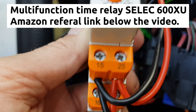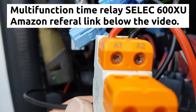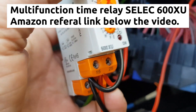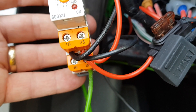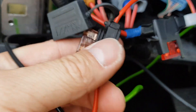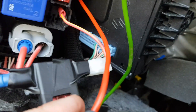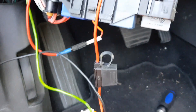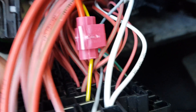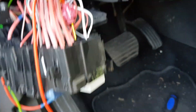From fuse number 25, you need to make a straight connection up to number A1. Then again from number 25 on the positive lines, I put a five-ampere fuse in between — so if there's any problem, there's always a fuse. This goes to the fuse box, to the positive power input of the relay. You can see the fuse, and then it goes to the yellow cable in the fuse box — there is only one yellow cable, and this connects to that yellow cable.